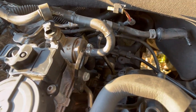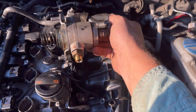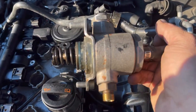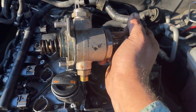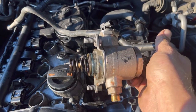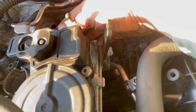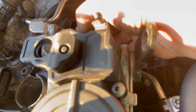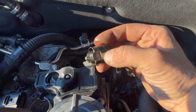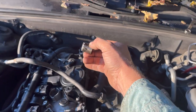I think I got lucky in this position where it was at the lowest spot. Pull this out and you can see both bolts are right there — one is too small or the other's too long; they don't even have the right hardware in here anymore. This blue O-ring is what I was talking about. It's spring loaded, so if you just take one bolt all the way out, it can cock sideways and drag that O-ring. It's probably a good idea to replace that O-ring every single time you remove this pump. Let's pull out this roller cam. It's a roller on this one — the previous model was not a roller and they wore through, damaging the camshaft and the high pressure pump. This roller setup has proved to work flawlessly so far.